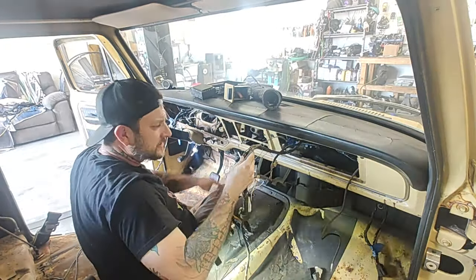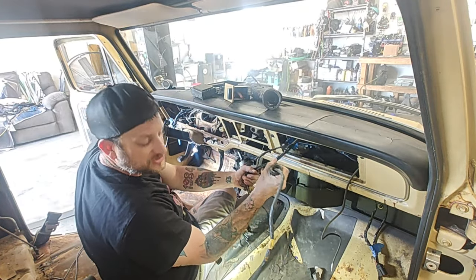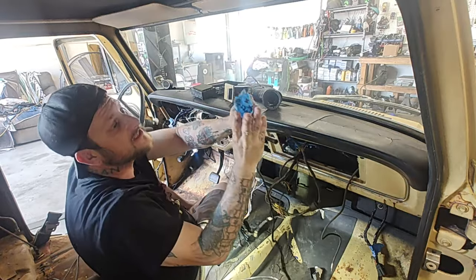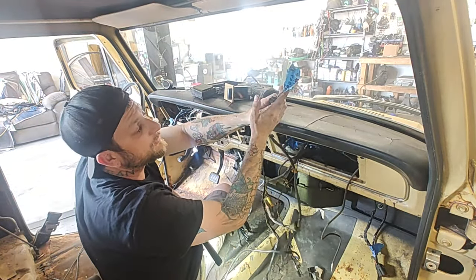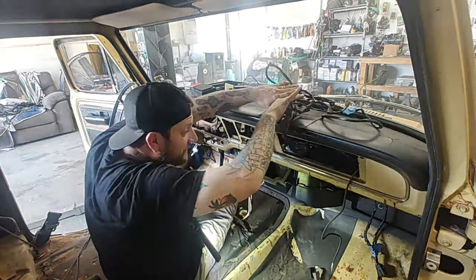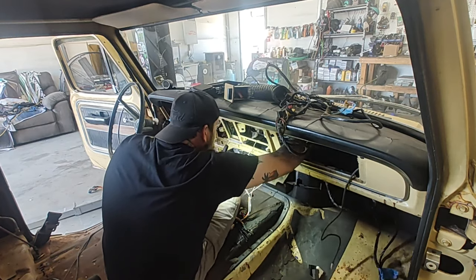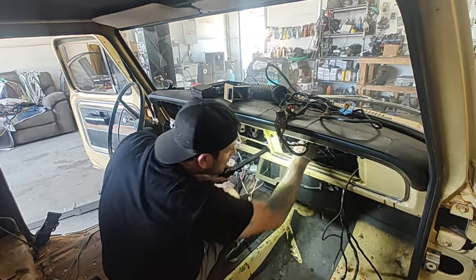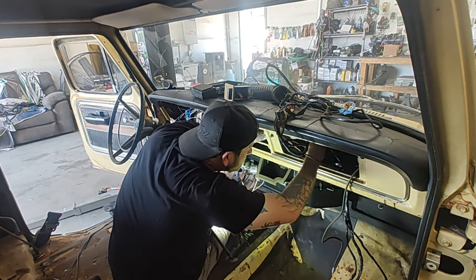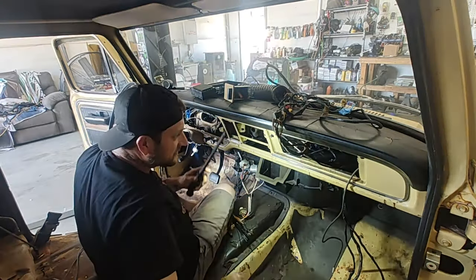This big chunk of wiring right here is stock wiring from the truck. We're going to put a hole through the firewall and run this grommet through. This end goes up to your passenger side headlight, except for this little chunk right here which we need to make sure we run to a battery positive — that's what makes everything in your truck work. We'll stuff it out of the way for now and get to it when we get the truck part done. We've made it to the part where your blower motor actuator can plug in now. We'll tear that tape off — we know where it goes — and boom, we've got our first plug plugged back up to the truck.